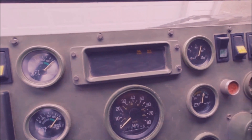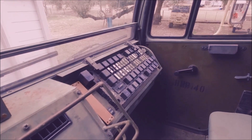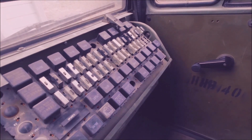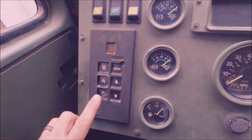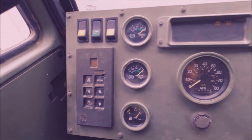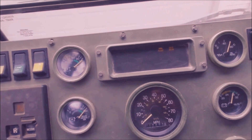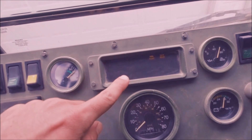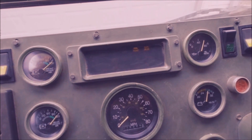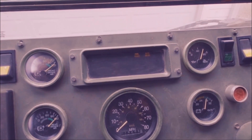I'm not getting my PTO symbol. I checked the breaker and the relay, replaced them with a new breaker and a new relay. The relay is engaging and the PTO button is still engaged, but the transmission will not engage. It's trying to do what it's supposed to do. It's one of two things: either I am actually engaged and my PTO light on the cluster just isn't lit — because when I do the lamp test that lamp is never lit up — or that temporary wire connection I made for the pressure switch is just not holding once I lowered the cab and started the engine.